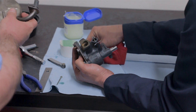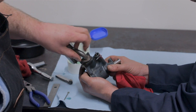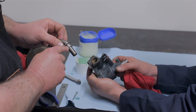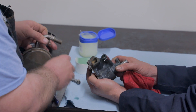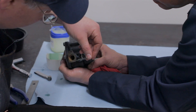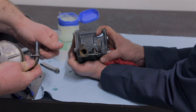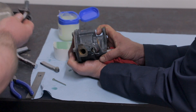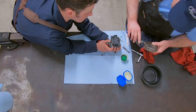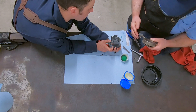Now we can take the pickup. You want to make sure the pickup has a nice tight fit — it's not sloppy — because there is no gasket or seal or anything here, just a little ridge. I'll show you how the cotter pin went in. When the cotter pin goes in, it retains it right in here. What I like to do here too is give it a little bit of petroleum jelly — that helps make a seal initially until all this is wet. Once this is wetted with oil, it maintains properly.